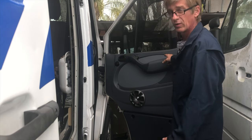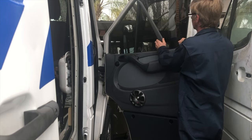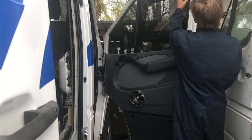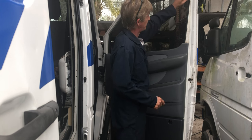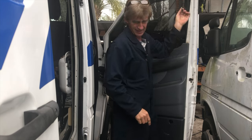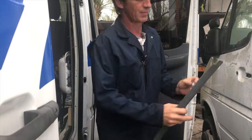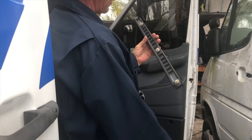But for taking the door panel off, first this little triangle up here, just kind of grab a hold of it, bump it out. We've got three pop-in connectors. One of them stayed behind in the door, so we're gonna go ahead and pull that out, like that. Slide it back into here. And now that's ready to go back in later.